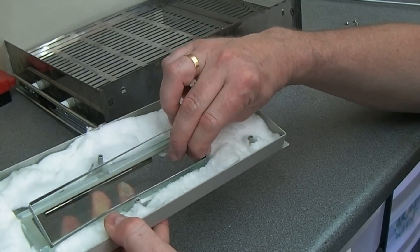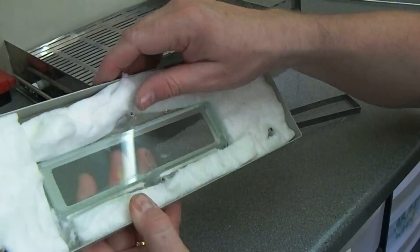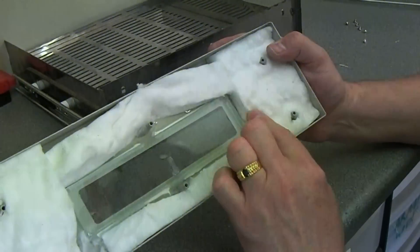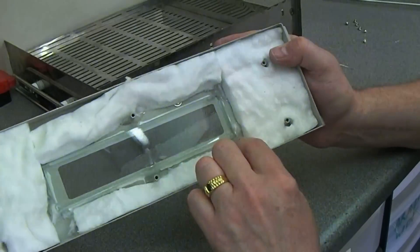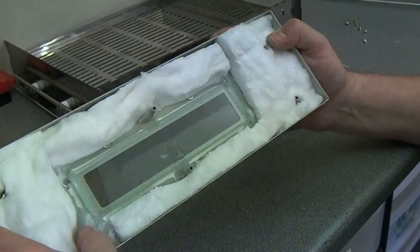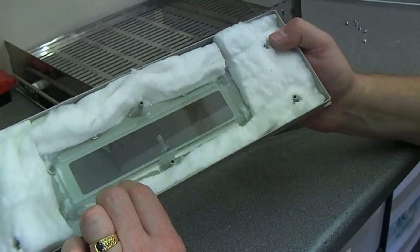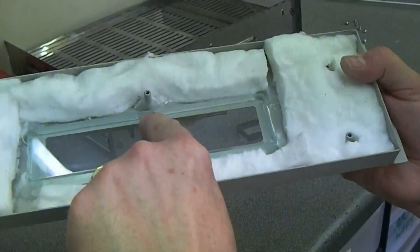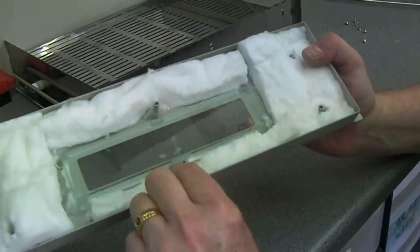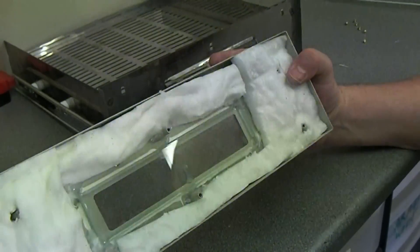I think we're just going to take that off and see what's going on. I wonder if that glue has been misplaced and it should just be on this pillar to hold the insulation in. There's hot melt glue in each corner — here, here, here, and up here again. I just don't understand why you would do that. Obviously they've used heat-resistant silicone around most of it but they've missed it here — you can see there's a gap, and there's a gap in this bottom piece, and that's where the glue is coming from.